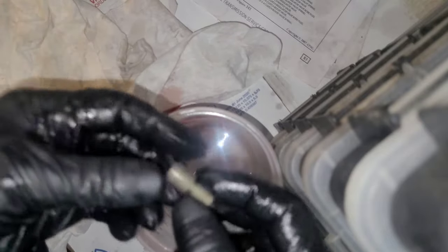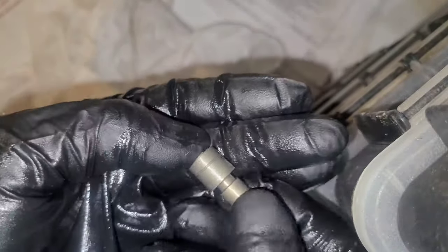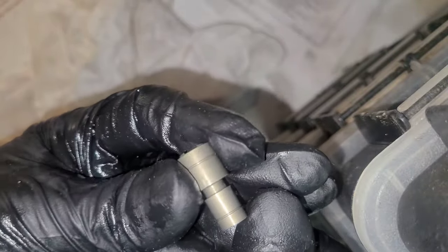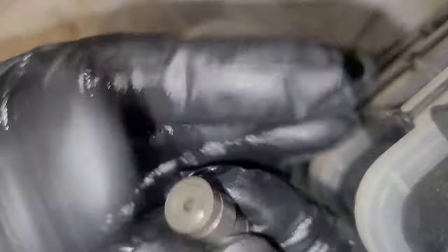This is 3. This is the regulator, 2-6 clutch regulator valve gain valve. A little bit of wear. You can see the scratches on the valve. But again, nothing too severe. I do wish I could afford to replace it right now, but can't do it right now. I'm already taking enough time off of work to do this project myself.